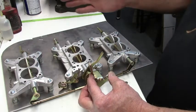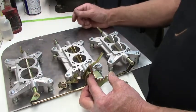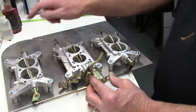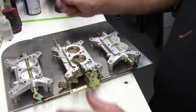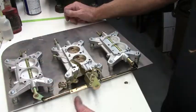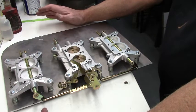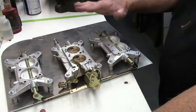So you're wailing along, you've got full vacuum to the pods that pulled these up. Now, when you get off the throttle, if you watch, it's going to close these outboards. See? It pushed them closed. Because unless you can push them closed, that vacuum pod's going to keep them open, running wide open. So that's basically the adjustment. That's all you need to do on these.